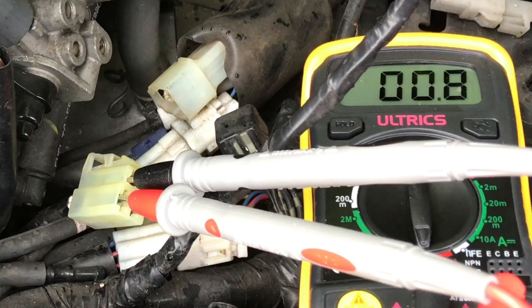So those were four tests you can do to test the charging system on your motorcycle — basically testing the alternator and stator. Today this was on my Yamaha FZ6, but these pretty much apply to any motorcycle as long as you have the readings from your specific manual. Please let me know if you've got any other tests you think I should be doing. I've tested the battery — that's brand new so that's fine, I'm pretty sure that was the issue. The alternator and stator seem completely fine. If I have further issues, that could be the regulator rectifier — I do know how to test that. Please let me know your thoughts in the comments, hit the thumbs up, subscribe, and I'll see you in the next video.